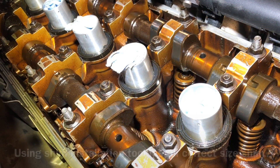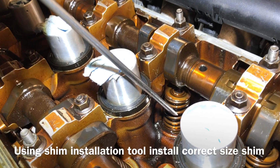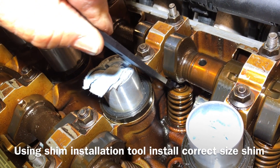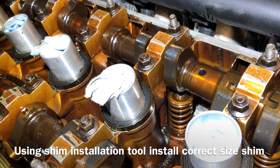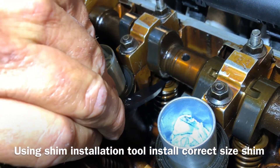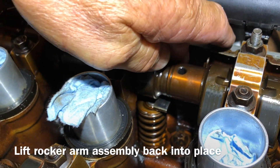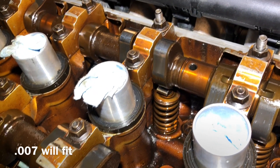We have our little shim on our BMW tool. Looking inside you can see the spring retainer and right here is the valve stem — this little shim goes right on top of the valve stem. To install it, we come in with the shim, put it in the area it fits into, and wipe it off with the back side of the tool, making sure it's laying down flat. Just touch it — don't wipe it too hard because you don't want to knock it off into the engine. Then you pick the valve train up and slide it over. Now we're ready to check for proper fit — again it's a pass/fail.